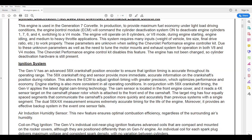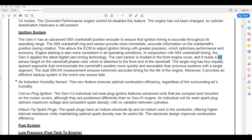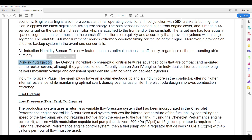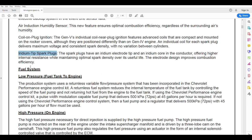The ignition system is coil-on-plug. We have a 58-times crank sensor and a 4-times cam signal, which means the computer knows where that crankshaft is within a couple of degrees in the full 4-cycle mode, giving better fuel and ignition delivery. The LTs supply a humidity sensor, so humidity is another variable we can take into account for better fuel and spark control. Coil-on-plug means each cylinder can be individually controlled, and if there's a failure, you're running on 7 cylinders instead of none. Iridium tip spark plugs are a big advantage — you can pull them out with 80,000 miles on them and they're still working well.